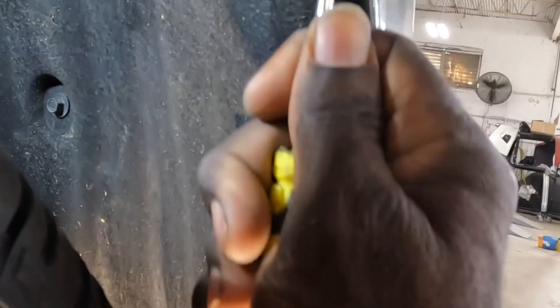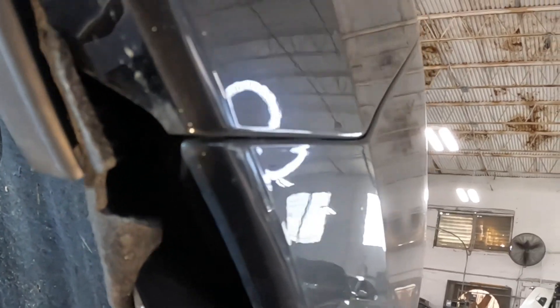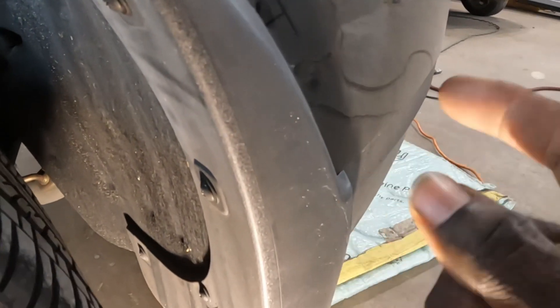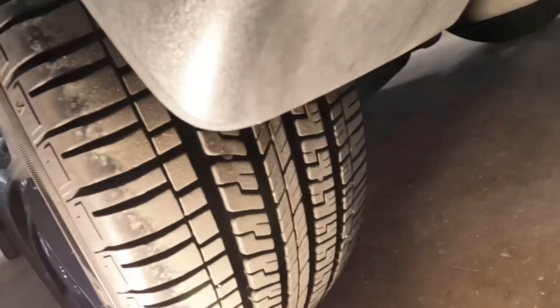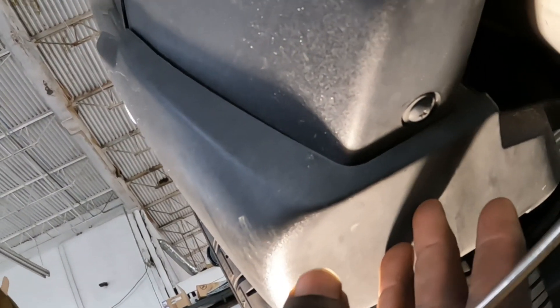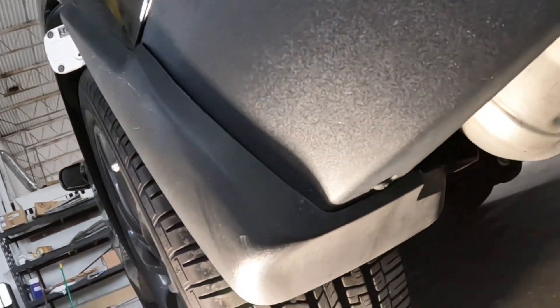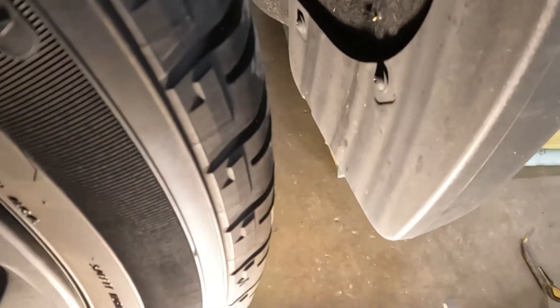Open this up just like this and move this piece out of your way. There's a screw right there, and another one right up here on top — it's also a Philip head. Take the screw from there. Set this piece back out of your way and take the screw from right there. Once you guys take off this piece, there will be two more screws up underneath here — one right here and two more up underneath. Once you get this piece out of your way you'll see those two screws.